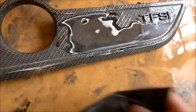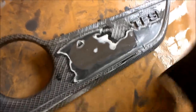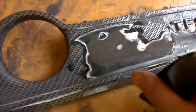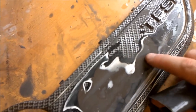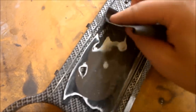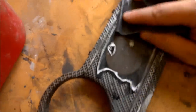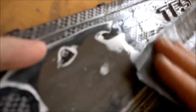A little note I'd like to add: I've done my 400 and I've gone over the entire thing with 600, so it's nice and smooth now. Something worth mentioning: if you're getting a little drag with your fingernail — as you can see, the plastic here has paint there — the bit where it joins is this area. You want to sand against the grain. So for this section, left and right. For this bit here where you've got paint and plastic, you want to sand up and down, sanding against the joint. If you start sanding side to side on that particular bit, it's not really going to be as effective. Whereas if you sand up and down against it, you're going to get more effect against the grain and where it joins.